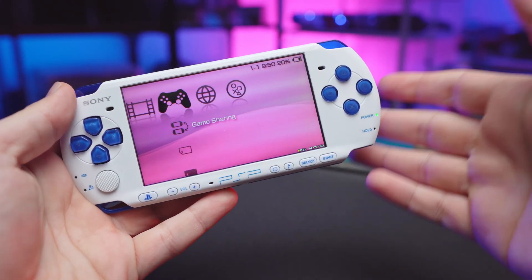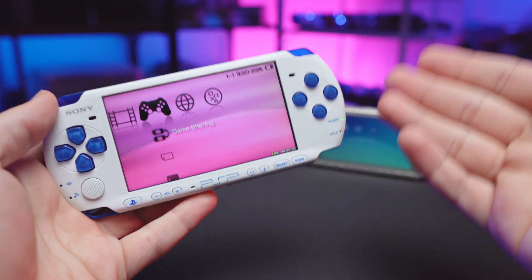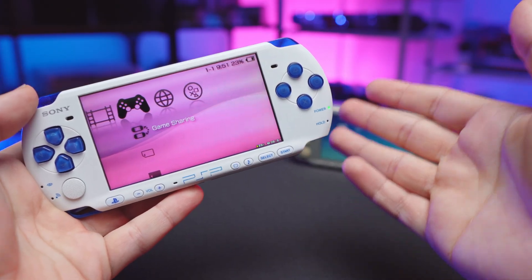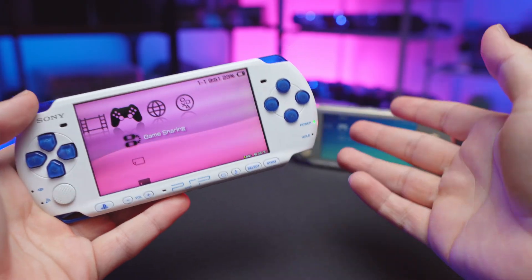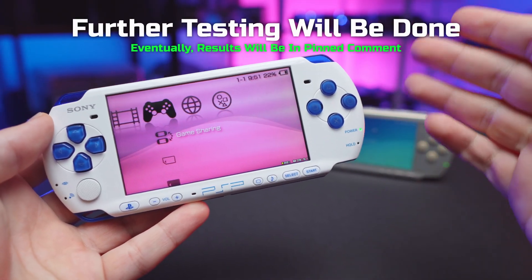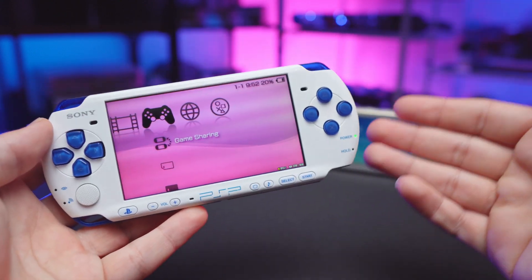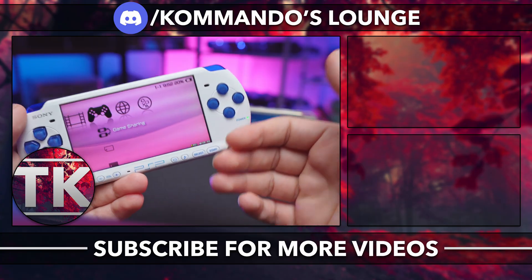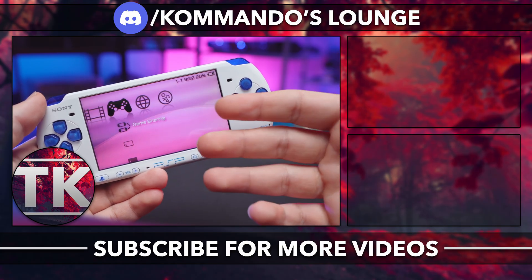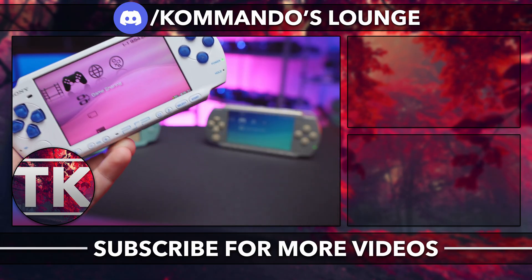And that's really about it for this video. If you've got the right tools and a little bit of experience, you can easily pull this off. For those who just want to test out and see if their PSP can be revived by removing or disabling the supercapacitor, the fourth method — peeling the top off, taping it, and closing it back in to break the circuit — is something that everyone should be able to do, so long as you know how to disassemble your PSP. For those who don't know how to solder, I've got a few things planned, so stay tuned. As for how long the supercapacitor should last — probably a couple of hours — I tested this by charging them for around five hours, leaving them unplugged for another five hours, and only got the time screen a couple hours later, which should be plenty of time to swap your battery. Usually for 1000/2000 models it's not a major issue, but for the 3000 model it's been known to cause various issues — for example, you plug in your PSP, it turns on, but then after you turn it off it doesn't turn on for at least another two hours. Thank you all for watching — if you enjoyed this video and found it helpful, hit the like button and subscribe for more content like this. Take care everyone!